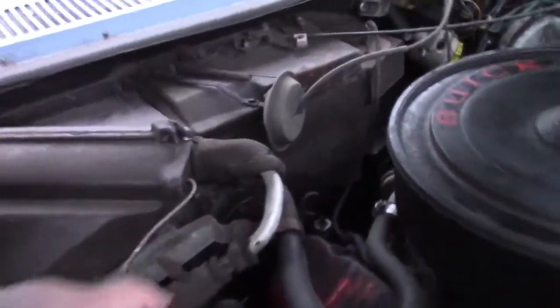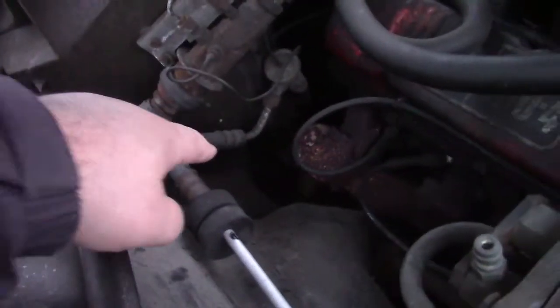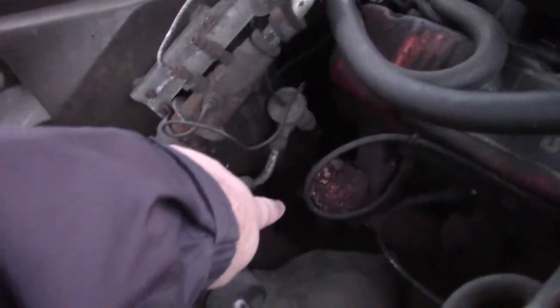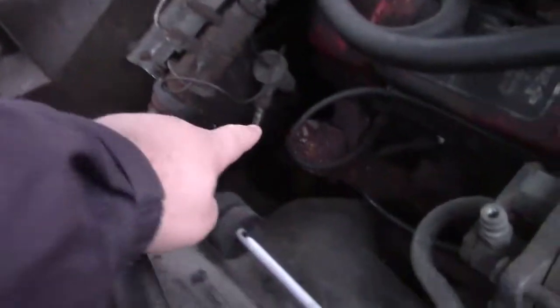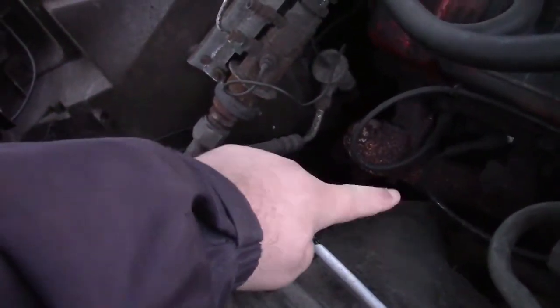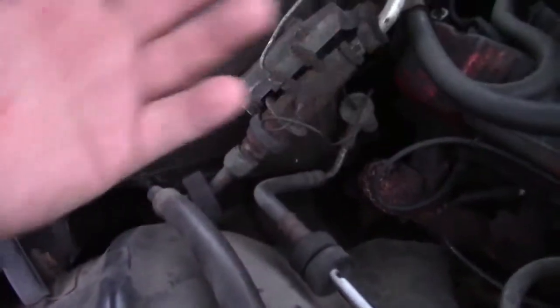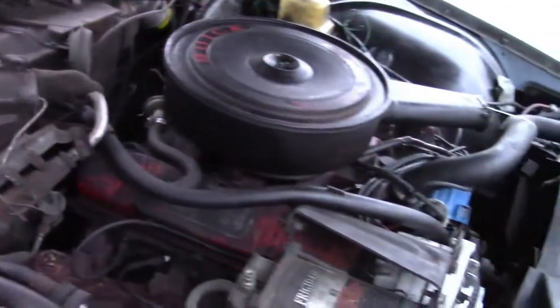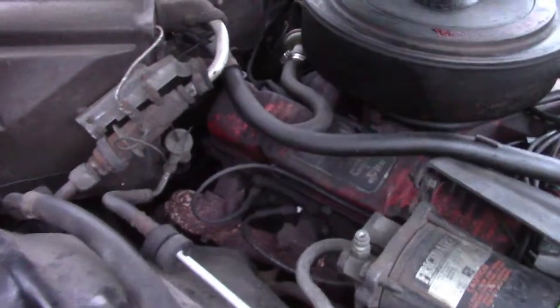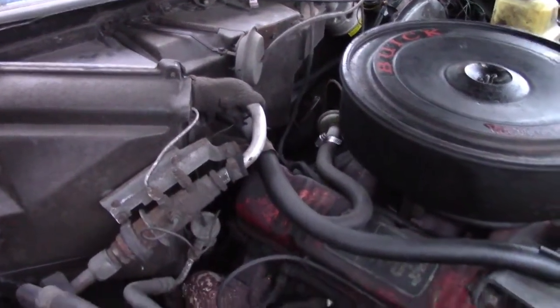Like I said, it's not leaking from the hoses where it goes in there, but it leaks, like, I don't have enough daylight anymore, way down through there and onto the ground, kind of underneath where it would be, but a little further back. I think it's dripping on the exhaust manifold or the exhaust pipe on this side, and then it drips off of that and onto the ground. It doesn't matter, unfortunately, if the heat is turned on or off, so I'm not really sure the entire function of that heater control valve.